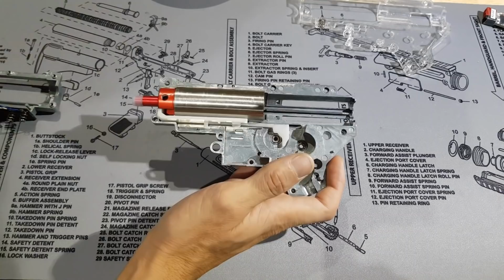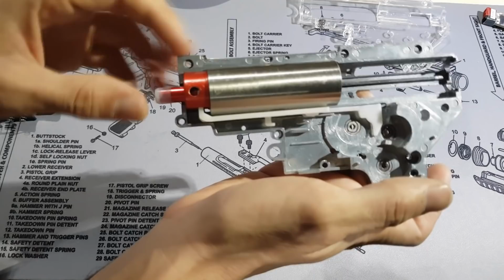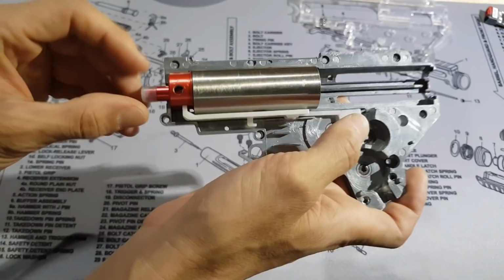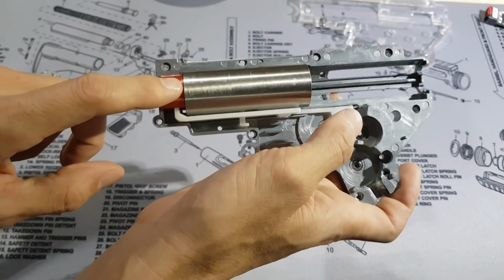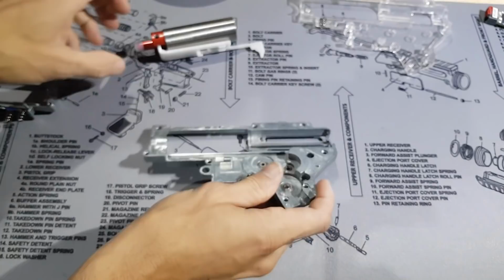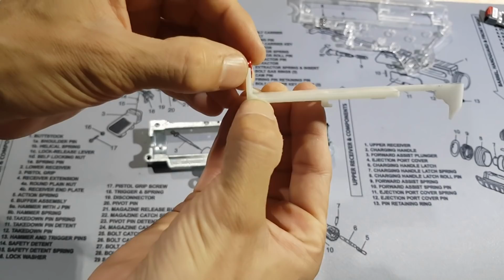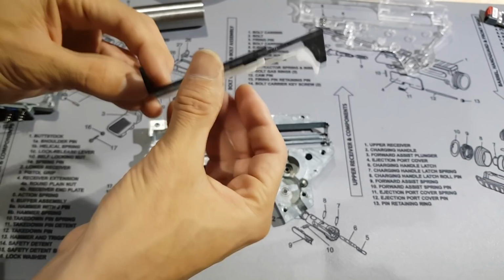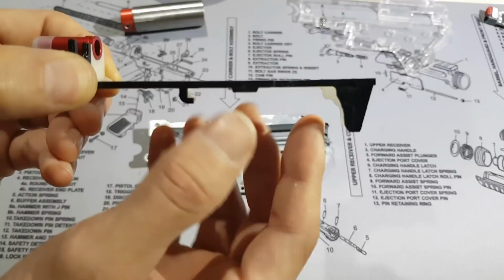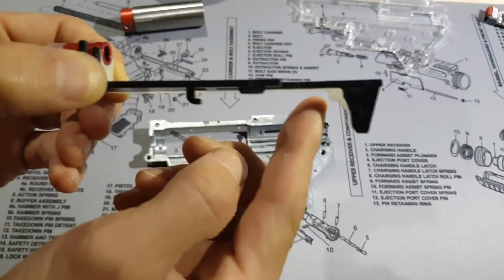You can see here in the APS box, I get to there, and the tappet plate can't go back any further. Focus. Yeah, see, I can't get it all the way back to the front of the cylinder. So even with the Wells cylinder head and the Wells cylinder, can't get it all the way back because of that rail just there. Now, like I said, the easy way around would be to either Dremel that or to use the APS tappet plate. I could do that. I just like that the Wells tappet plate profile has this early opening notch here, just a little bit that opens it up a little bit more.